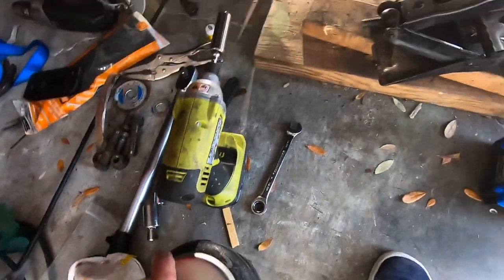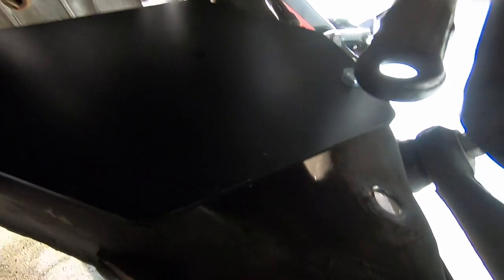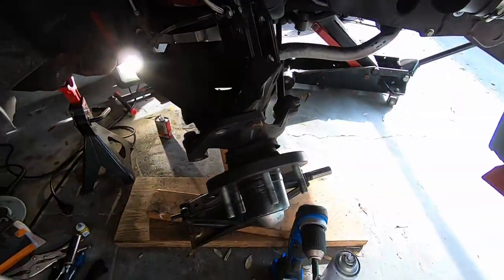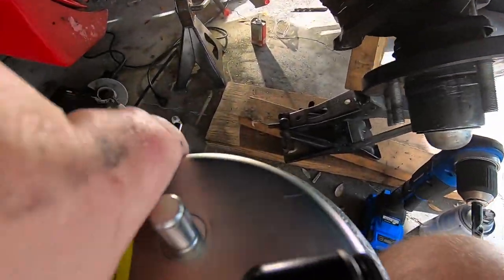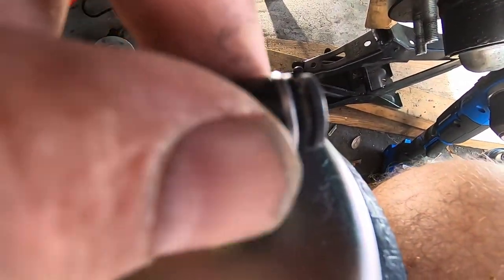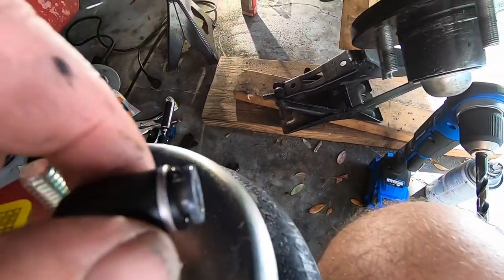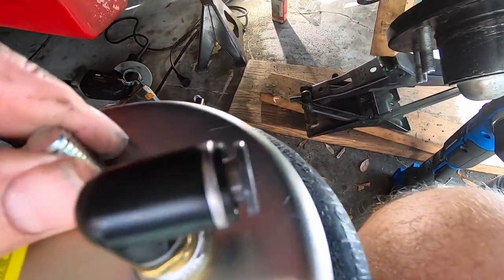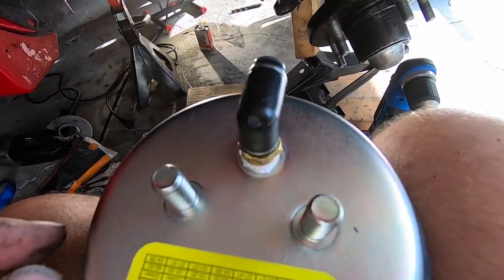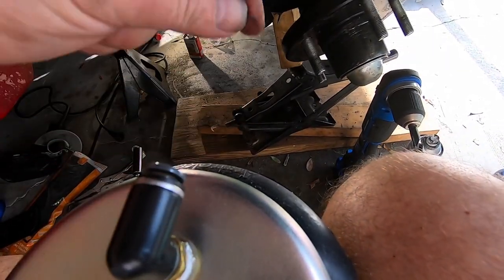Next, we're on to the installation here. We got the lower plate on, all bolted on, ready to go. So this bag will go on there. Then the top part is what we're dealing with here. I screwed in our elbow here, a 90 degree air fitting, and that is a swivel, so you can clock it the way you need to. The way they describe this is you want this pointing towards the middle, towards the engine. So it's going to be like this, right? Looking back at the engine. And then your airline's going to come out here.